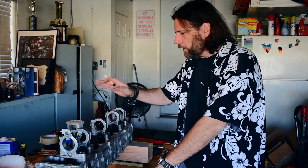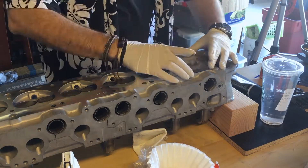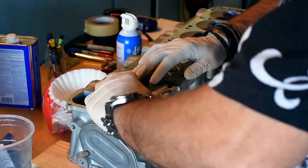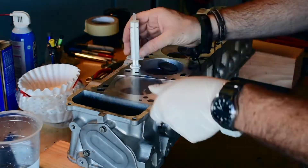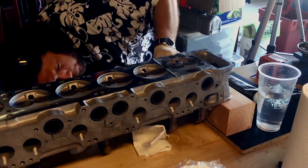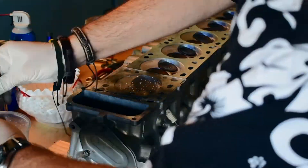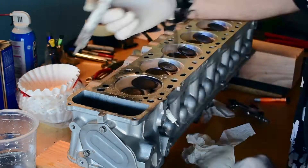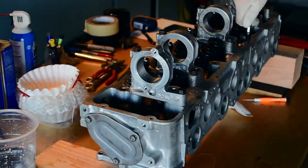I'll be putting it all together and seeing how it goes. I'll also be measuring the volume and the lift on the camshaft today. Unfortunately, I didn't do a good job at measuring the volume — I never got an accurate reading. My eyedropper would always shoot out the water too fast. At one point water was leaking into the water jacket, another point into the oil passages. My plexiglass was a bit too big. So I gave up and started measuring the camshaft instead.